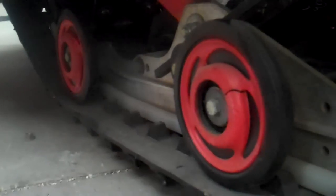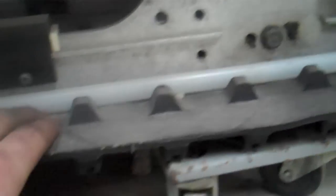Check your torque arms — make sure there's no cracks in them. Check your bogey wheels and make sure all the bearings sound good. Bearings are cheap and easy to replace before the wheel goes bad. If a bearing goes bad, it's going to take the wheel out, and you're going to need a new wheel and bearing. Check your track tension — it's hard to tell here because it's sitting down. Your hyfax usually has a wear line on it. This one's probably due to be replaced. Remember, right here is probably going to be the thickest, but up in the bend is where it's going to be the thinnest. So don't let the thickness at the back deceive you — it could be thinner up front. Hyfax are cheap; suspension rails aren't. Go ahead and replace those if you need to.